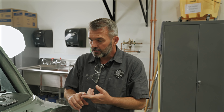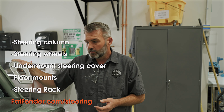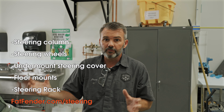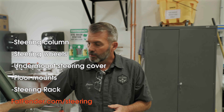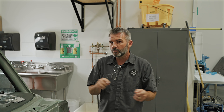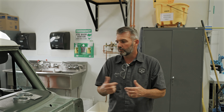Several cool products we've talked about in the video: a steering column, steering wheels, the undermount steering cover, and these really cool parts that help install all this. This is available on our website — you can purchase all this stuff ready to go. You can purchase it as one big kit or buy them individually if you just need specific pieces. Now, this kit only works with a two-inch column. So if you have a two-and-a-quarter or something a little bit bigger, this won't work for you. These are designed to work with a factory column — which is two inch — or a Flaming River column.